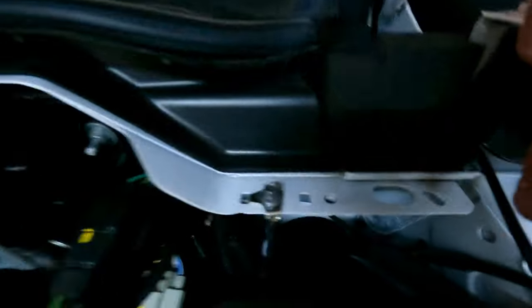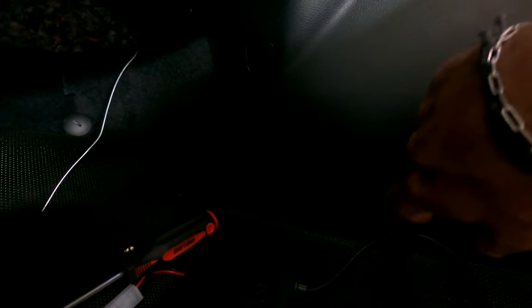What a mission to run the UHF aerial wire! In the grommet down there, there's like a little nipple you can cut, feed through — happy days. Turns out on the inside you've actually got to cut the inside of the plug too, and it's quite hard to get your hand up in there to cut it. But we worked it out, we got it done. All I've done on the inside is fed a bit of wire through from the driver's side to the passenger side, right at the front of the firewall. Going to tape the power wires through and keep the base of the unit in the passenger side.